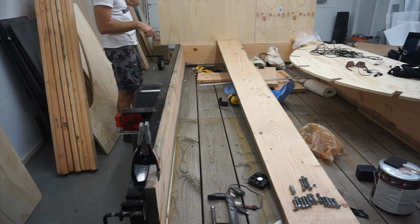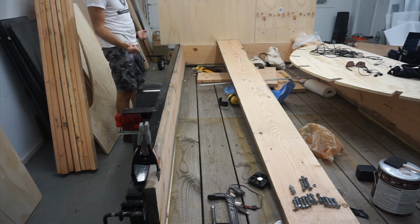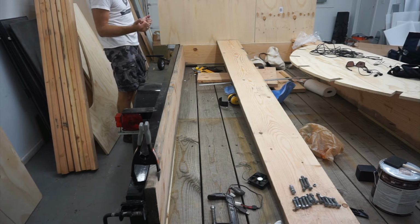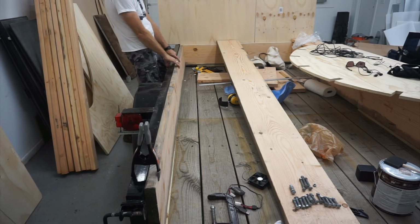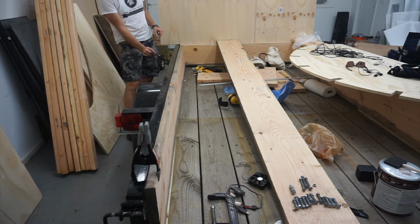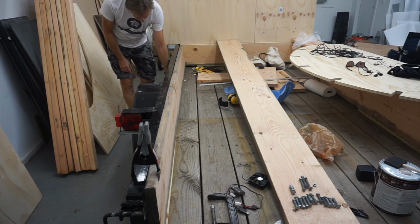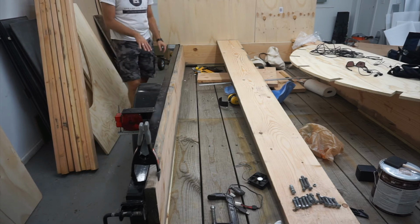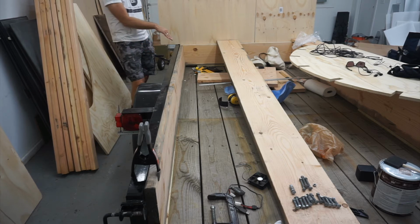There's actually one additional step that we'll get to, to pull the board nice and tight to the outside of the trailer. But we'll get to that, because what happens is you can attach this as tight as you want up here. What sometimes happens is there's a little bit of a gap formed at the bottom edge of this board. It doesn't exactly line up with the trailer framing down there. The board kind of cups in a little bit.